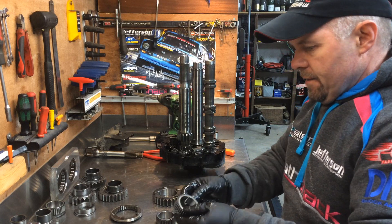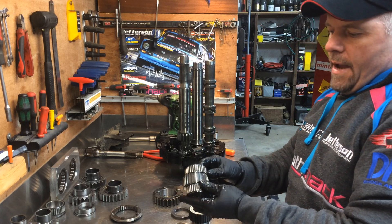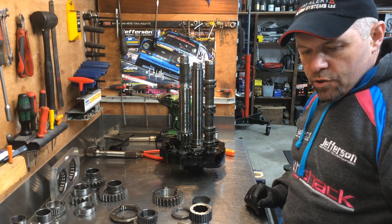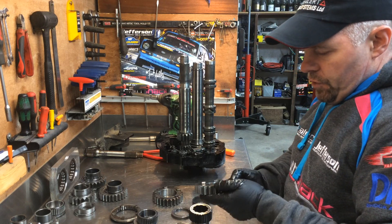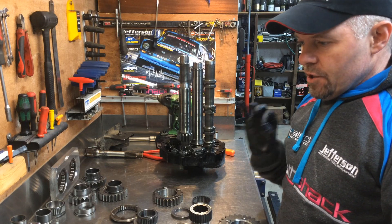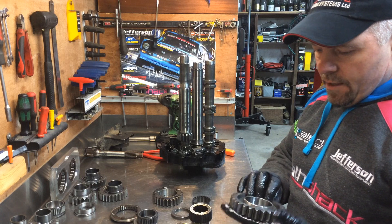All these spacers and needle rollers are pretty much the same throughout the whole box — the spacer where the dog ring runs is the same across all gears, so you don't have to worry about putting them back in the same gear in the same place. There'll be six of one and three of another and they're all interchangeable. So everything's good — all I need is a second gear. To be fair, you could probably rally it for another three, four, five, six rallies and it would likely be fine. But this car is going abroad next year, so I want everything just right. I'll keep the old one as a spare but change it just to be sure. The ratio and everything's written on it so I can get it ordered up fairly quickly.